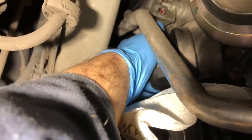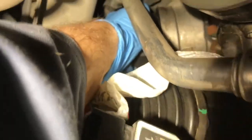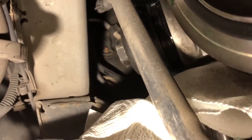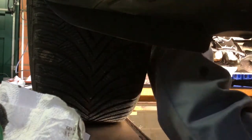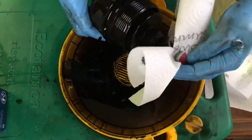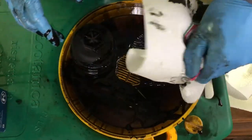Now it's time to make a big oily mess by removing the old oil filter. I used a 32 millimeter socket to break free the filter housing, but it's a bad angle to film so I only got some images of me unscrewing the housing by hand. The designers decided to put the oil filter upside down, so when removing the filter all the oil that's in the filter comes right out — it's quite a big mess. The oil filter housing contains the old oil filter; you can just pop it out like this so all the old oil drains out.